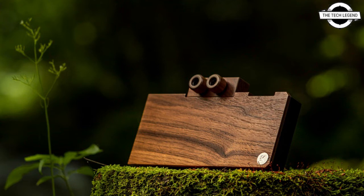It features optimized flow paths that reduce hydrodynamic instabilities and vortexing inside. This signature edition product comes with an included back plate that was specially designed and fabricated only for the EK Quantum Vector RTX 3080 and 3090 Lignum water block. The anodized aluminum back plate has a flap on the side.